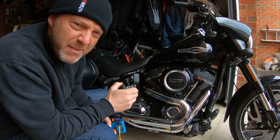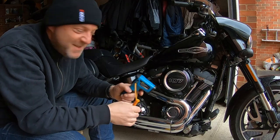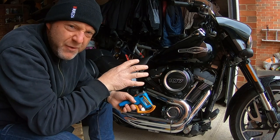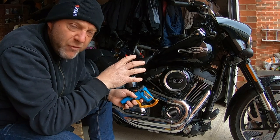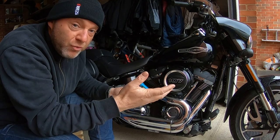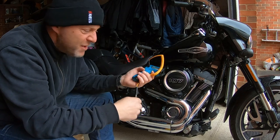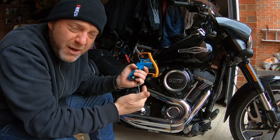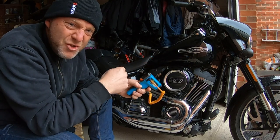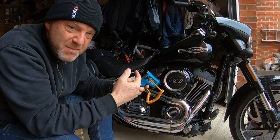So I'm going to turn off the engine now and measure the oil temperature. So a bit of an odd reading there. Basically the bike, after about 15 minutes, the engine heads got to just over 100 degrees Celsius, which is in the kind of operating range of that engine oil temperature. But actually, when the engine oil gets back to the reservoir, it's very hard to measure — this isn't picking up on the probe. The probe is working correctly because I've tested it on other things. But the engine oil seems to cool down really quickly when it comes back to the reservoir, so I was only getting mid-20s there.